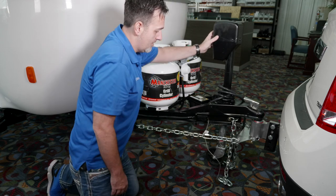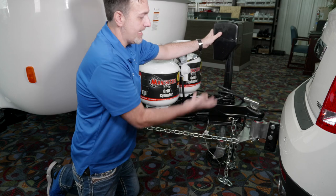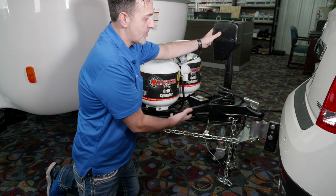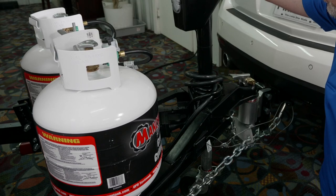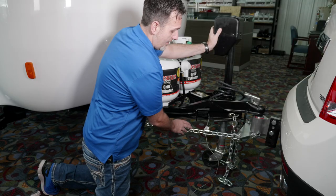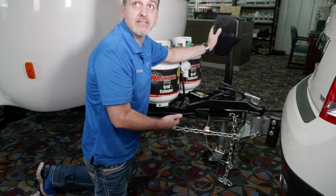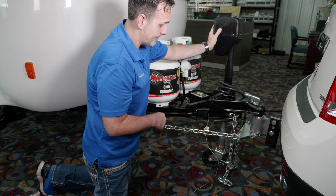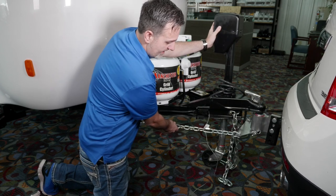To remove it, what we're going to do is lower it down. When I lower it down, I'm picking up the trailer and the vehicle together. The reason why I'm picking it up first is I want to get all the weight off the chains before I relieve the pressure so they come off nice and easy and don't snap back at you. Just a few more cycles until they get loose.